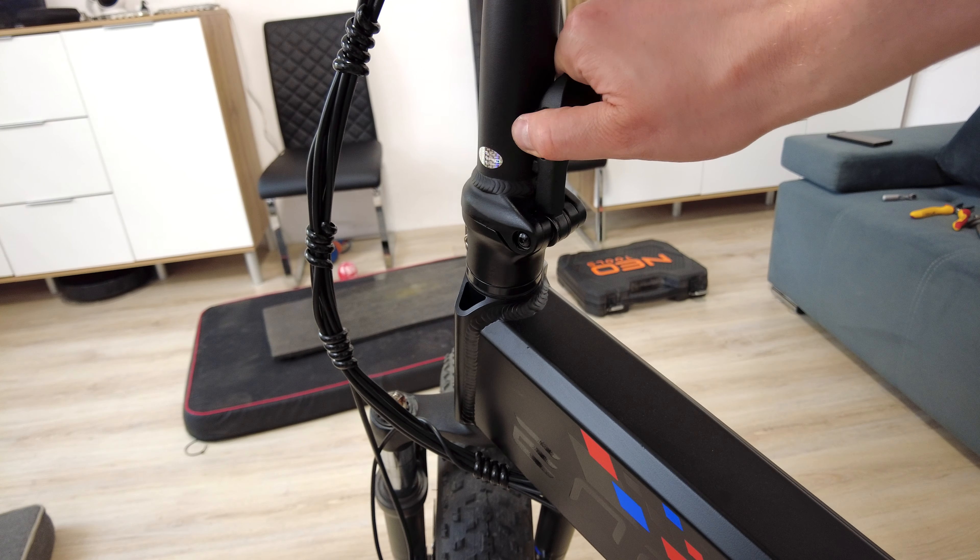Now you have to delicately and quite precisely tap this top part — I can't find the hammer, so this is the funny part. This ring was just blocking this part from going up. This is actually a simple MTB system. Check this one out — one of the balls is missing from the bearing! Even without that one ball inside, I didn't feel that anything was wrong. This is a simple MTB bearing so it will be easy to find a replacement.